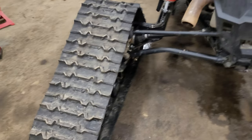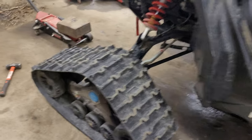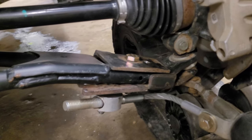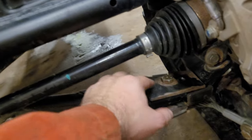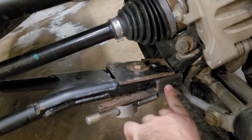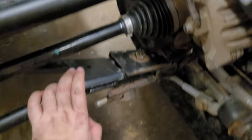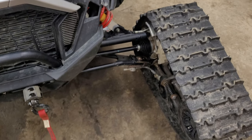So that's A-arms all the way around, and the back is completely custom. For mounting the fronts, we modified the brackets that came with it. Since it was A-arms but on the Pro XP's they're a little more high-clearance, what we did on the front is basically take the bottom A-arm — normally it's completely flat — and the top one which normally kind of comes and wraps around. We cut them up, bent them, moved the brackets in to make it fit, shortened the top bracket to deal with the arch, then made a little piece that wraps around with one big half-inch grade 8 bolt right through the middle. We just finished putting it all together and it looks like it's gonna work just fine.